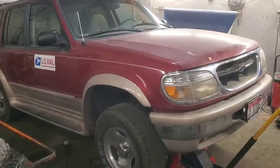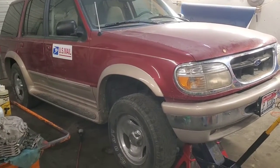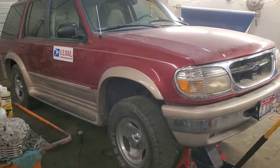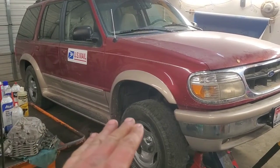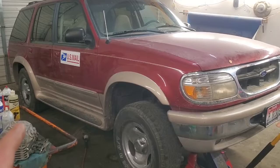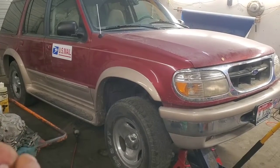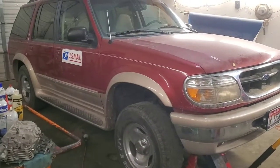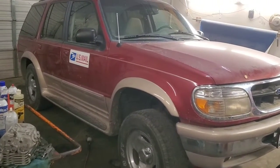It's just trying to lock itself into four-wheel drive. I'm not quite an expert on these, but essentially the theory of operation is there are magnetic clutches inside the transfer case. The rear wheels drive it all the time, and when it measures a difference in speed between the front and rear, it starts engaging those clutches gradually — it can't just lock it in four-wheel drive all at once or you'd get a big loud clunk.